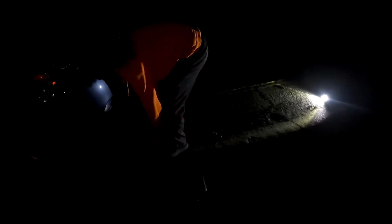All right, so explain to the viewers what we're doing right now. All right, so we're putting the ramps underneath to get the car up to be able to fit underneath to get the drain plug off. Okay. Some people might have a question, well, wouldn't that not leave the car level? It's okay if the drain plug is at the back of your oil reservoir because it's all going down.